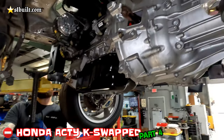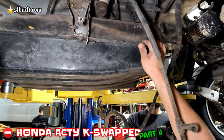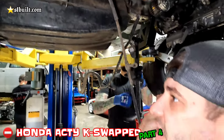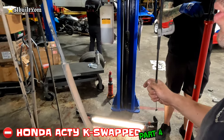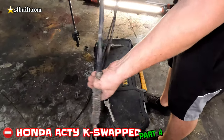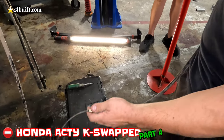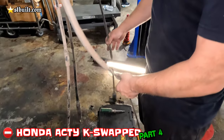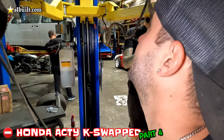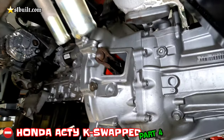We're getting things going more on the truck here. Basically, what we're doing today is we're going to pull this gas tank down and figure out how to adapt it to get a different type of fuel pump, either external or internal. Right now I'm pulling a bunch of cables down — removing the cables and lines we're not going to use. I'm going to keep the shift linkage. This cable is the old speed sensor cable, so it's getting removed. This was an old clutch cable because it was a cable-driven transmission, and now it's going to be hydraulic, so we're removing this. This cable over here is going to be throttle, so hopefully that may fit in today and we might start making some bracketry for that.